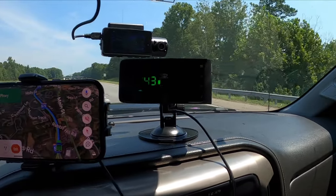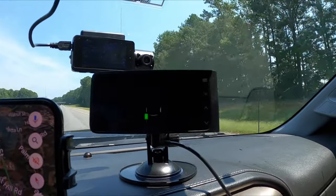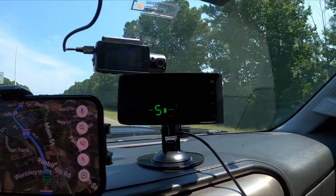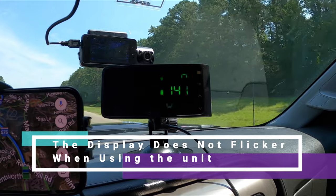We've been doing highway speeds for about 25 minutes now, 60 to 65 miles an hour, and everything is still scrolling through — looks pretty good. It's showing battery voltage: 13.2. Then it scrolls to PSI: 93, 91, 90 — that's good. Temperatures are all within a few degrees of each other: 140, 145. Looks like the repeater location is working.